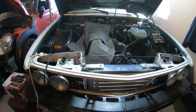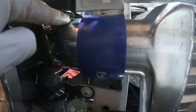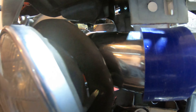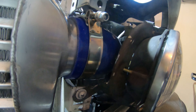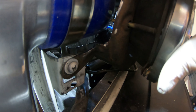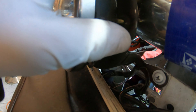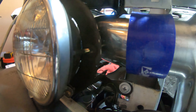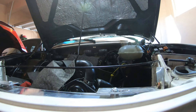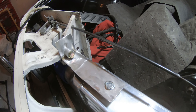All righty, here's the final look over. I just got the brackets mounted in — I'll give you a look at them in a second. We've got clearance all around here, plenty of room up and down there, and this is three-inch piping right there. I shaved down the headlight housings along through there, same on this side over here. Headlight adjustments — I'm probably going to have to cut down this stud a little bit, put a different nut in there so we don't hit the piping; it's kind of close right there. For the brackets, I had some scrap aluminum laying around, just kind of bent it up into some L's, drilled through them a bit, and got that all squared away.